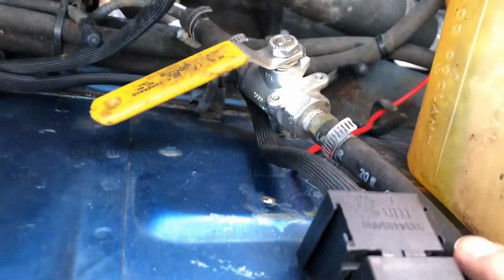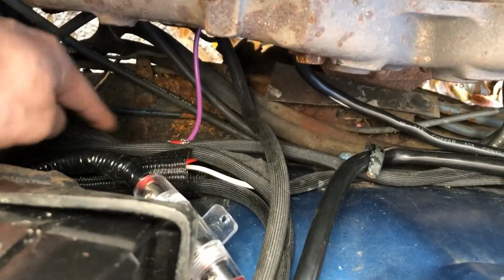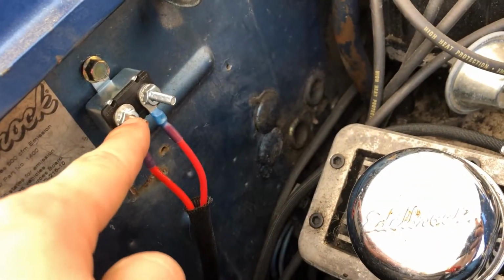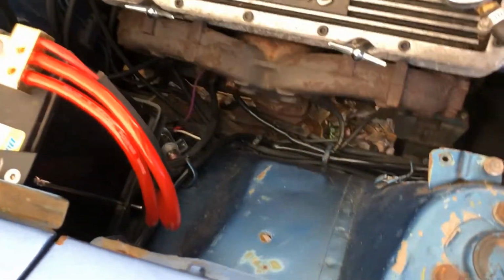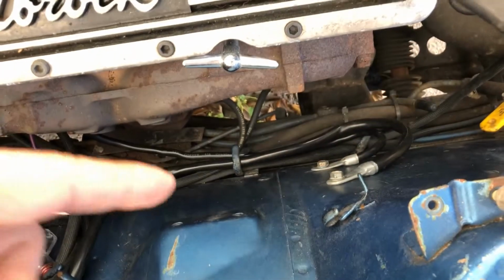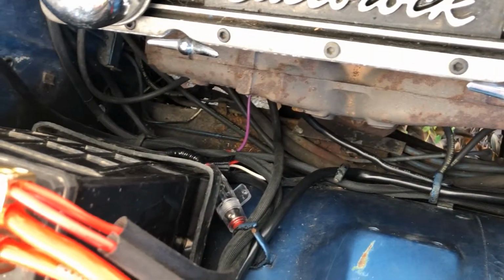Alright, the other three wires run through the sleeve. One going to the ignition switch, which splices somewhere in this area. And the other comes to the circuit breaker, and circuit breaker back through the sleeve and eventually up here to the battery. Might get a bigger jacket or sleeve to put all these in. I don't know. It's much cleaner than it used to be.